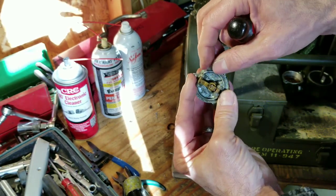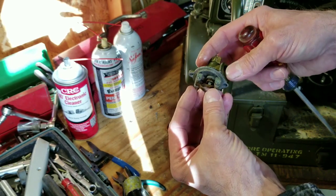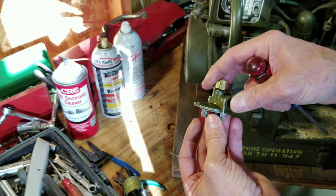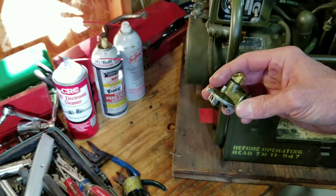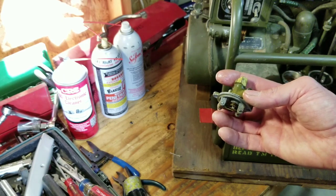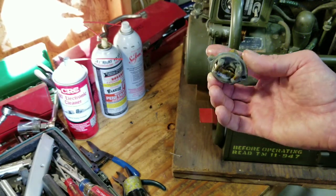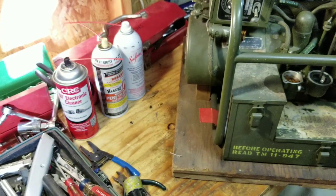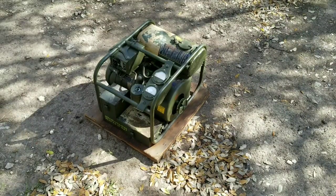The fix here is to pull these pins to disassemble the hinge, release the needle valve itself, clean it all up, put it back together, and hopefully have free movement and fuel cut-off as the carb bowl fills up — that way you can prevent flooding. Just a quick demonstration of a classic carb problem: with flooding, you're likely to find a stuck needle valve in your carburetor when you get flooding or overflow of fuel. So clean it up, reassemble it, and give it another shot. All right, carb's cleaned up and reassembled.